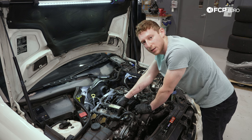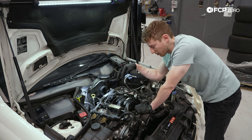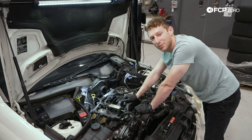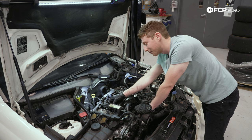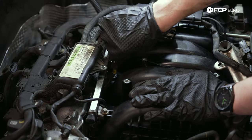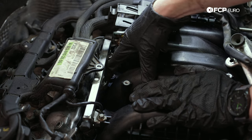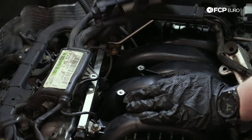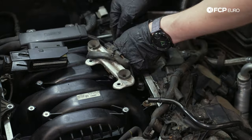Make sure you push the injector connector down so it clicks, and then press on the gray tab so you hear an additional click — that will ensure it is locked into place. If it hasn't locked into place or is not fully seated, you will get some very funky drive dynamics, as one of the injectors will either be intermittently firing if it's a partial connection, or not firing at all. I have one more to do on the passenger bank and then three more on the driver's side, and then we can move on with some additional steps.